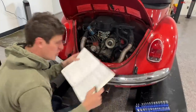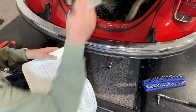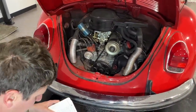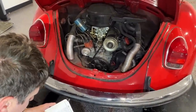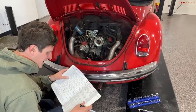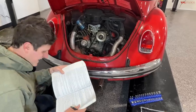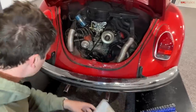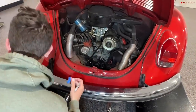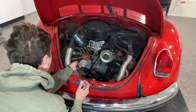So we're going to turn to page 241 here. Step one: prop the lid open so it doesn't fall on your face. Step two: drain the oil — done that. Step three: electrical disconnection. First, the oil sensor underneath the distributor — the plastic thing with the six-sided nut that activates the oil light on the dash. I love this because I use words like 'plastic thing.' Each wire was disconnected one at a time and labeled with painter's tape, and there's only like a 99% chance I got it completely wrong and we're going to be screwed when we go to put the engine back in.